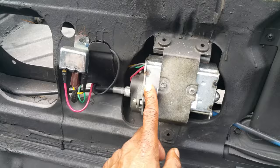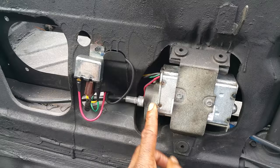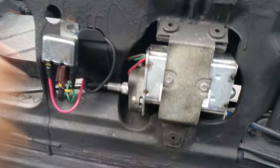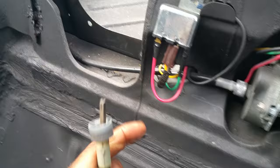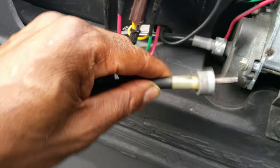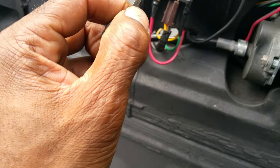The motor starts turning and you got your transmission gears. Transmission gears are usually nylon gears. It depends on which way you turn your switch — up or down — the motor going to start turning inside. When the transmission gears start turning, they're going to turn the cables. I brought one of the cables out so you can see how it works. It got like a box end; it fits into the groove inside of the transmission and you screw it in. Sometimes these will round off and your top won't move even though you can hear the motor running. You want it square — if it's rounded off you're getting nothing.